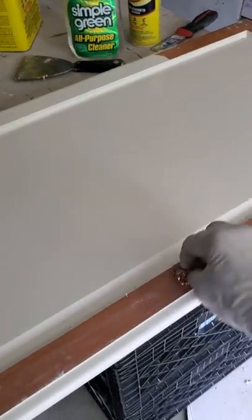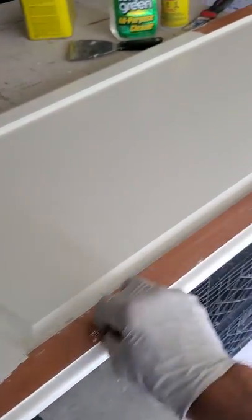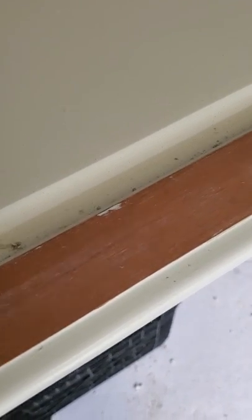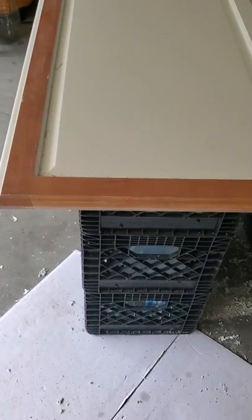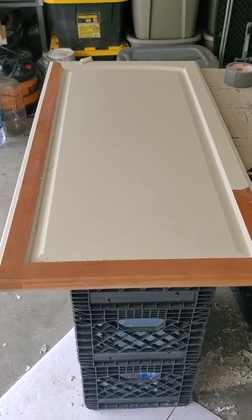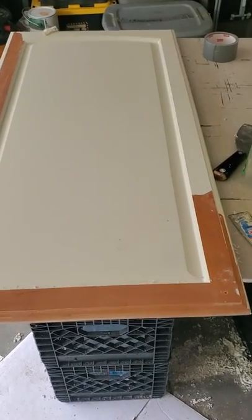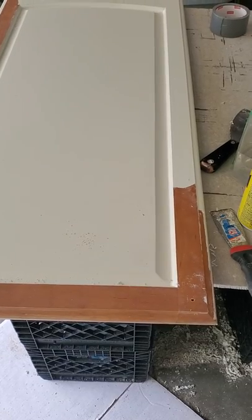Just a quick go-through with the wool lets me get rid of any leftover primer. If there are any trouble spots, I'll spot treat them. I'm not really worried about a little spot here or there, because if it didn't come off with Goof Off and steel wool, then it's not going to pop off after I paint them again. So that's pretty much the process I found that will make your life easy if you want new paint on the cabinet doors and want to do it correctly — not just paint over the existing paint — because sometimes that just causes the new paint to pop off. All right, good luck.